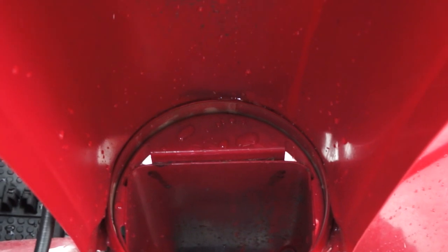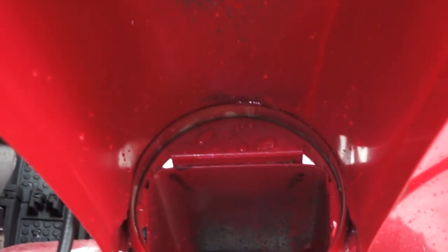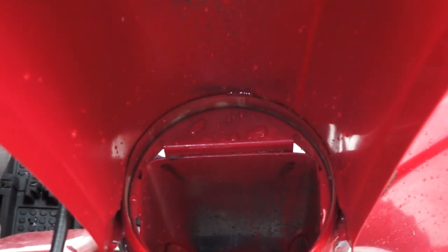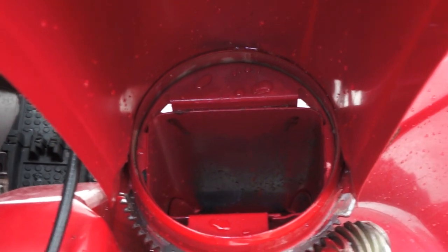And I used a spring-loaded center punch so that I could get it perfectly centered, and also had the plates so I could clamp them right down to it and get them perfectly in the right place so that it's well balanced, because if you don't have it even on all of them, it's going to be spinning off balance, and who wants that?